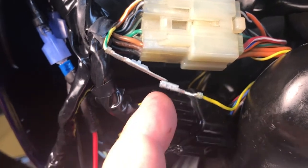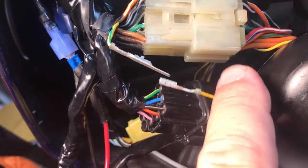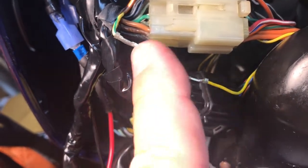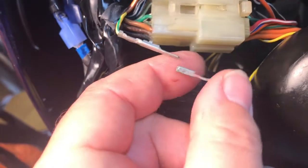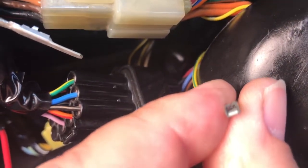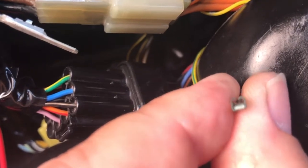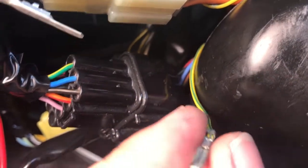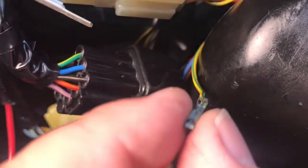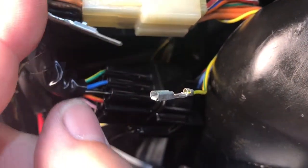I believe what is happening is when this wire bundle moves, this was free floating inside this female connector. She's a little bit spread out. See how there's a gap in that? So we need to pinch that together a little bit, being very careful because these are very fragile. They can be replaced real easy. I'm just out of these particular connectors right now.